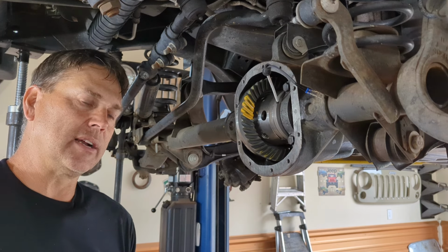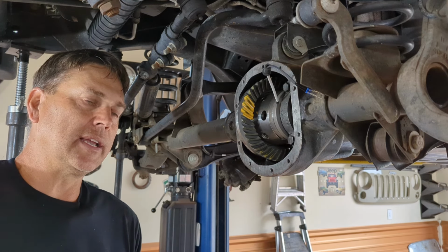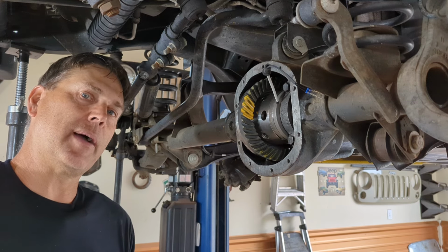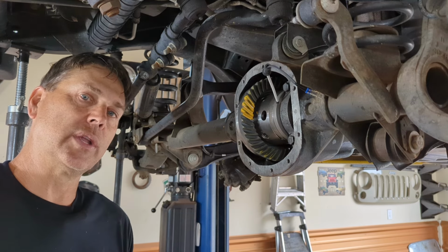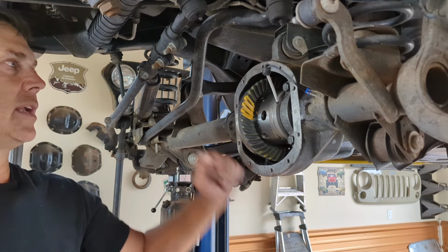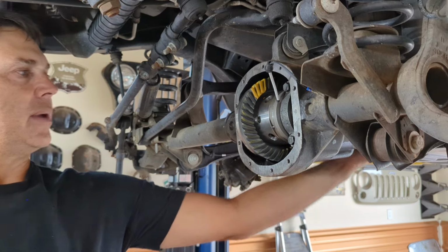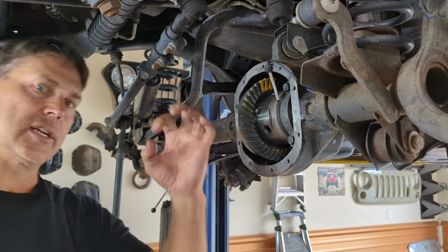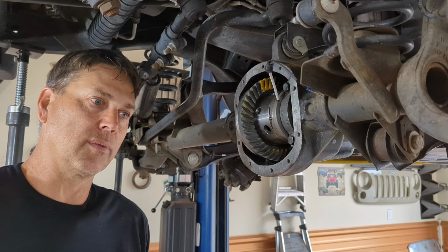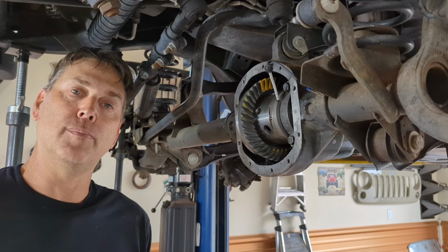You know, Yukon's a gear distributor, Revolution Gear and Axle, all these people do gears their way. The thing I like about Revolution Gear and Axle is they only use Circle K gears. So when you look on the ring gear, there'll be a marking there and you're going to see the letter K with a circle in it. You will get that in every single Revolution Gear and Axle box that you buy.